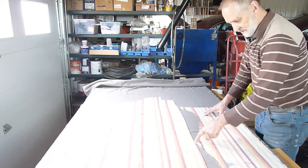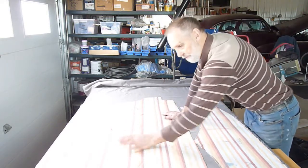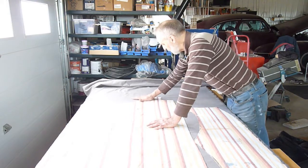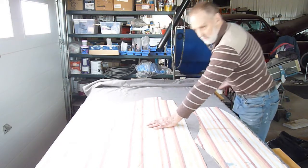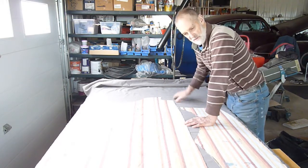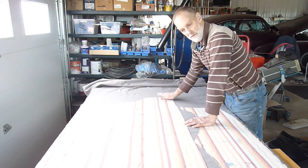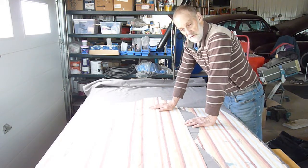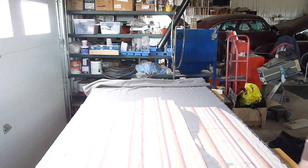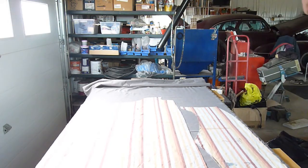The first pattern is the front of the windshield. The top goes up against the roof of the car. I'm working from the back side of the headliner. This is material I bought at a fabric store — it's about the closest match I could find. I've bought three meters of it because it's not wide enough to take these pieces, which are 64 and 65 inches wide. This material I think is 60 inches wide. Once I get these two laid out, I'll mark and cut them out and go on to the next step.